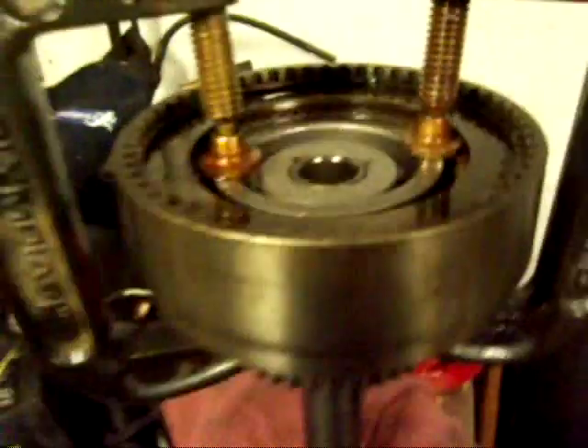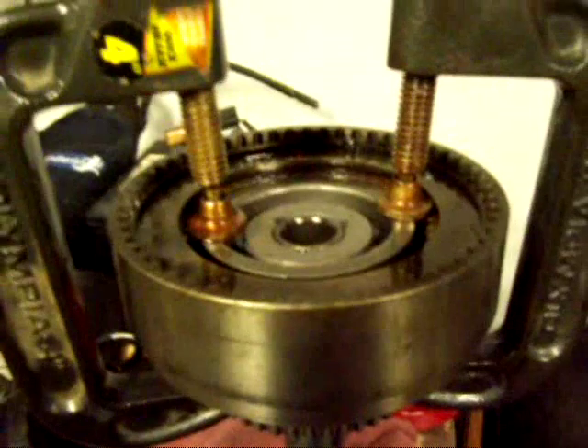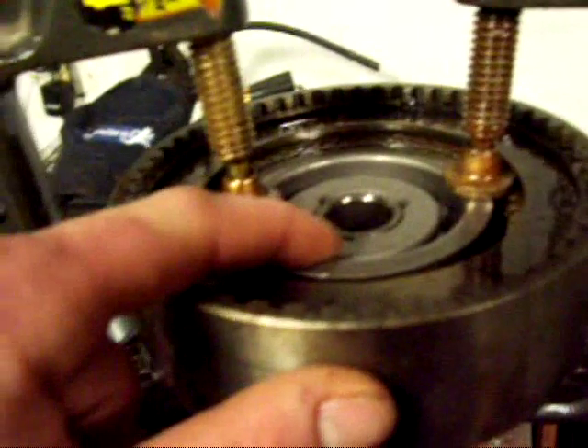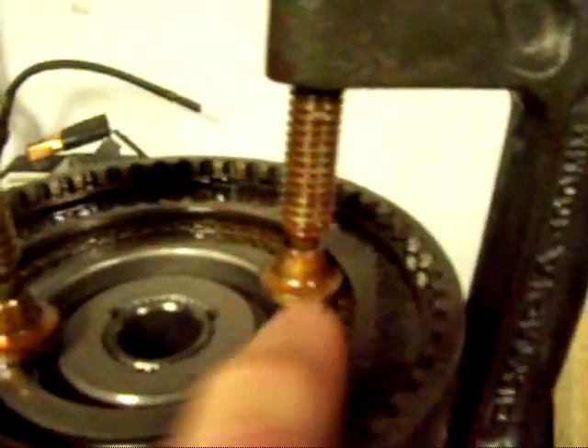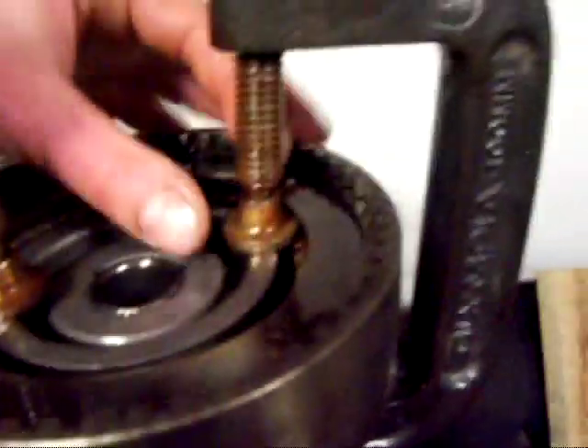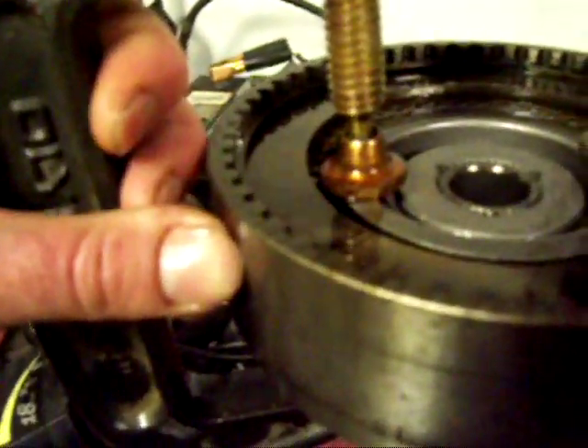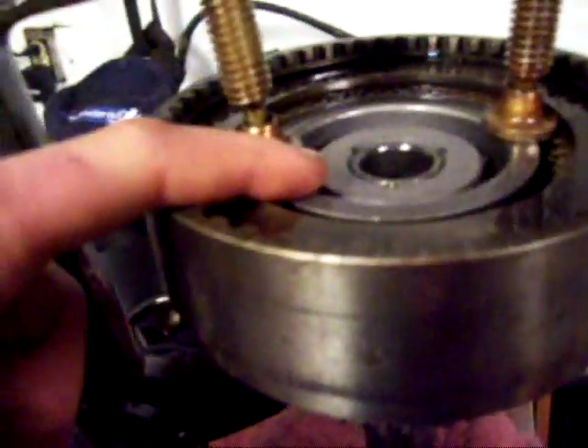I've got the spring back in, the plate, and my snap ring. It's pretty tedious work — you've got to have more hands than God gave you to compress this thing, because it sticks up about this high to begin with, and you've got to turn each C-clamp a little bit at a time. Now, there's a method to my madness why I put the clutch pack in before the spring: if this C-clamp slides back, it can't fall off and fly up and hit you in the face, because it hits this ring. See — it's not going to fly off.